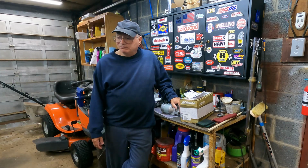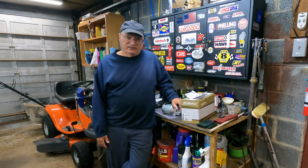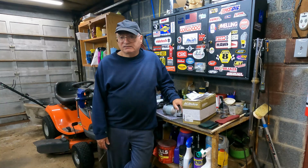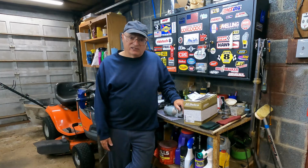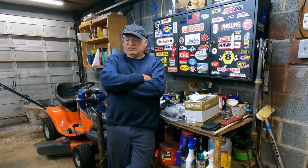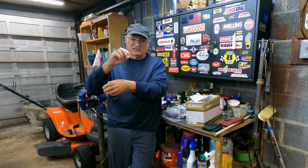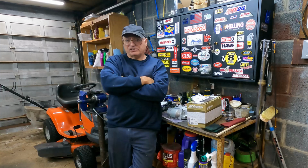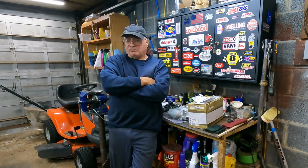Basically, jack the car up, and for safety use jack stands. Get under there, and after disconnecting the battery, unbolt the starter like I was saying. It may be more difficult, like I have headers, so it makes it just a little bit more difficult. You've got to maneuver the starter around and wiggle it around until you get it the right direction to get up in there, and then rotate it around into position. If you have the stock exhaust, it should just drop right off.